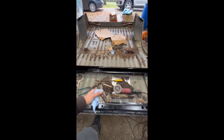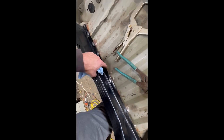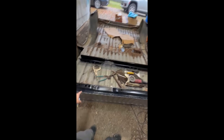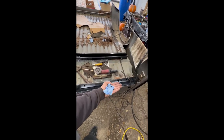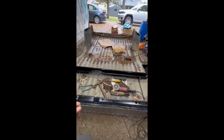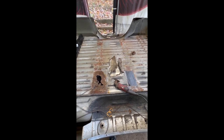Once you're all done, I can still get my undercoating gun nozzle in here and shoot it to hit underneath that flange and between the floor. The key is to do the inside of the channel — where it rests on the frame — because that's where the water is going to sit. Quick video here; I'm muffled because I've got my respirator on.